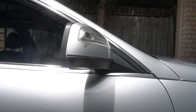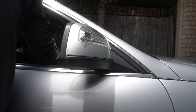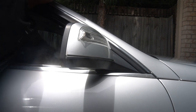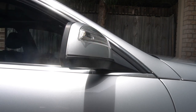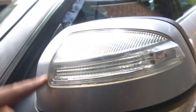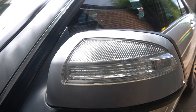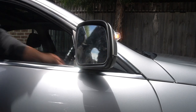And that's it — voila, side mirror fully replaced, ready to go. Let's just test it out now. Let's just indicate real quick — look at that, indicator beautiful once again! Look at that, sits in flush just the way it's supposed to. This is what the other side looks like — as you can see there is a tiny little gap all the way around, but that's exactly the way it's supposed to look. I'd say that is a job well done. Make sure you test the mirrors again, make sure everything works.